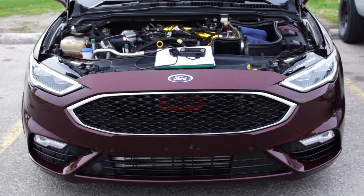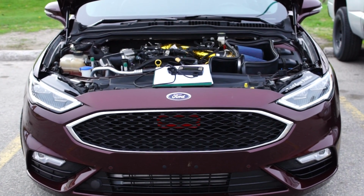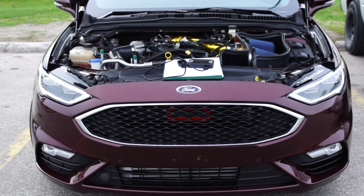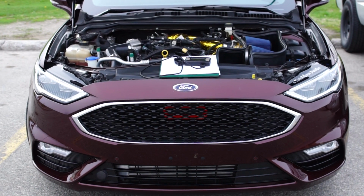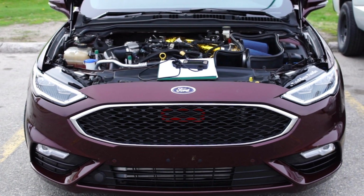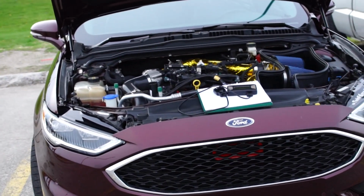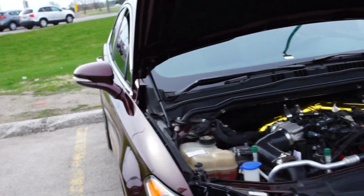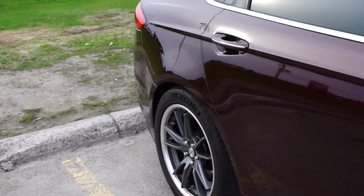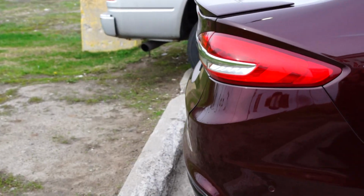So that's an option. But the intercooler is the single piece that will give you the most horsepower, just one piece. It gave me more than the tune itself, but don't install an intercooler without a tune. That's all I could tell you. The fourth upgrade that I recommend would be MKZ or Lincoln Continental turbos, the turbos that they are running on the 3-liter EcoBoost.